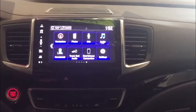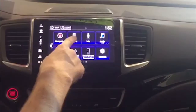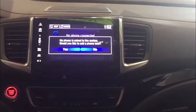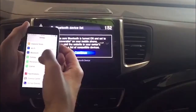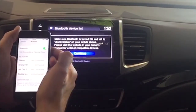When you get into your car, you turn on the display audio system to the home screen, and then you select the phone function. If there's no phone paired to the system, it will ask you if you would like to pair a phone now. So you just hit yes on the screen, and then you go into your phone, you go into your settings, you go into Bluetooth, making sure that it is turned on and set to discoverable mode.